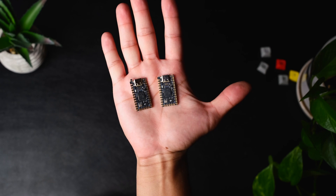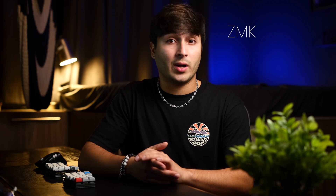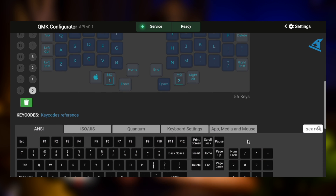The way you configure these layers is through the firmware that runs on your keyboard. Firmware gets installed onto the keyboard through a process called flashing. The firmware will be different depending on your microcontrollers. If you have wired microcontrollers like the Pro Micros or Elite Cs, then the most popular firmware is called QMK. If you're using nice nanos instead for a wireless keyboard like this one, then you use ZMK instead, which seems to be the most popular option nowadays. I found that QMK, which is the firmware on my Iris, is a little bit easier to work with than ZMK, especially because it has an online configurator that makes things pretty easy.